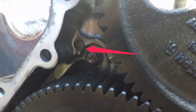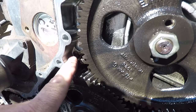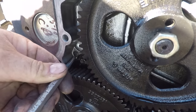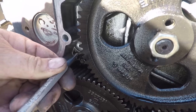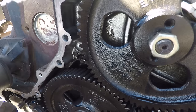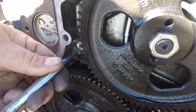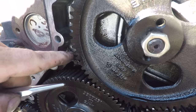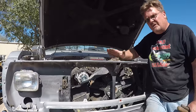There's the infamous killer dowel pin - it looks fine. A lot of people will sell you tabs and things that go in this bolt hole to cover up the pin, which is fine but it's overkill. Instead, take a regular center punch and tap the housing next to it - see how that indents the material? It pushes some over, and that is called staking. There's a lot of different forms: ball stake, line stake, but this is the simplest and easiest. Now the housing is folded over that pin - that's never coming out.